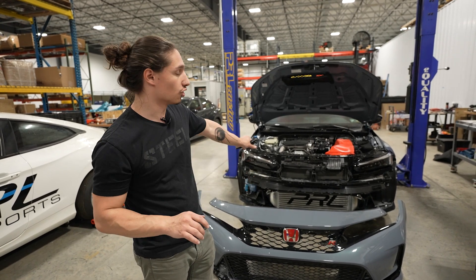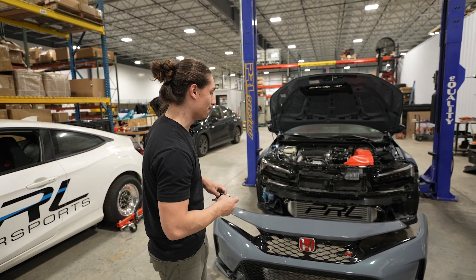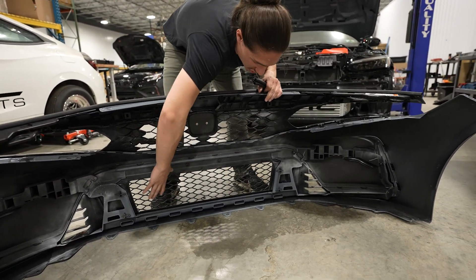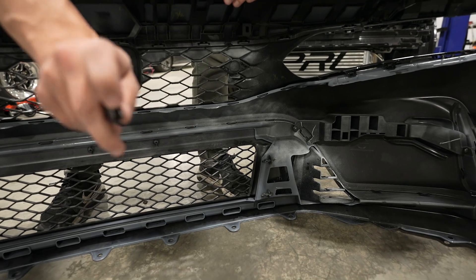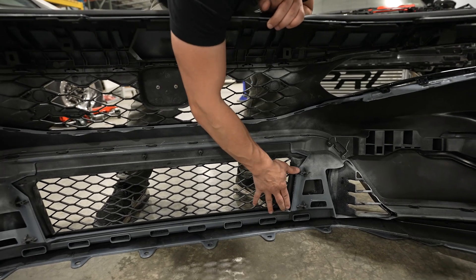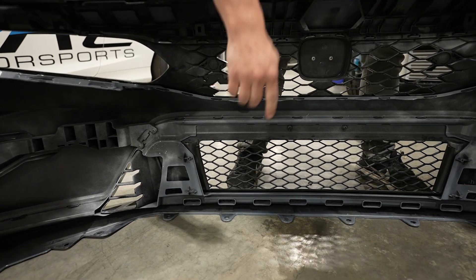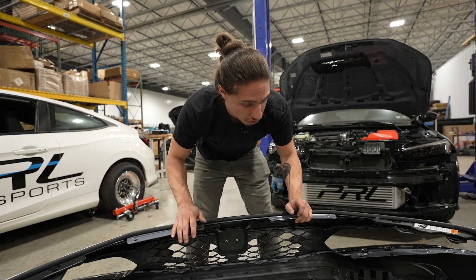I've got the bumper here in front of the car. The intercooler's got to come back off so I'm just going to toss the bumper on quickly for mock-up purposes. The core basically comes right up to the bumper opening, which means we can use these rubber sealing strips mounted right here on the bumper — they have stainless steel on the inside so they grip onto the plastic. You just push it right on, and once the bumper is on the car this will seal against the intercooler core, channeling as much air as possible through the heat exchanger itself.